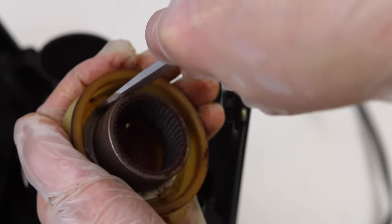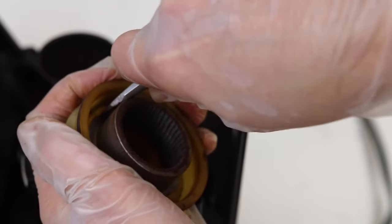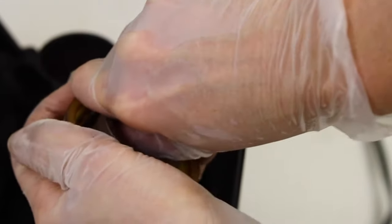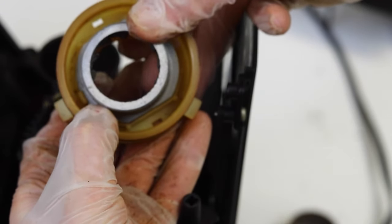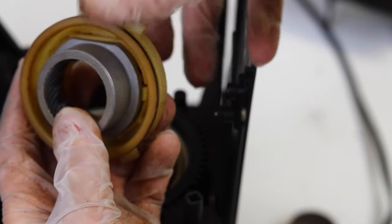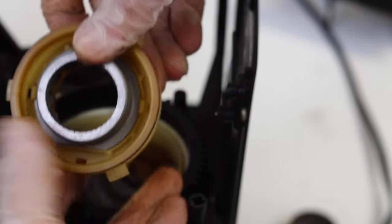Press in and remove the top burr, moving it away from the burr holder since we're replacing it. Press the new top burr back in: tuck in one ledge first — one ledge is already under that little clip. Apply force to the right side to seat the second clip. She's in.